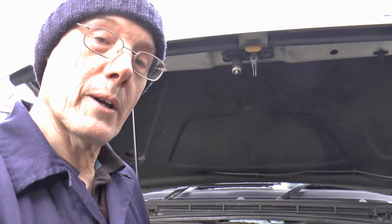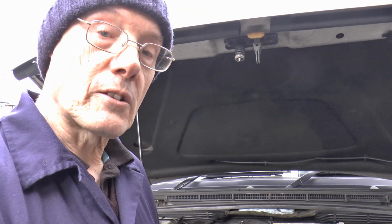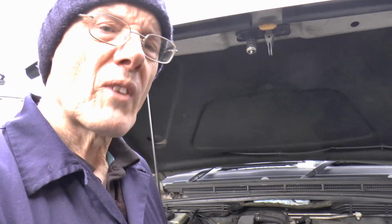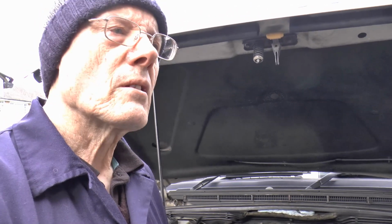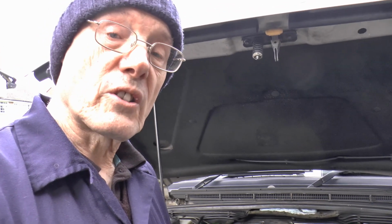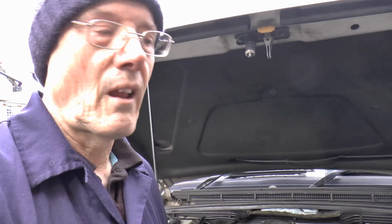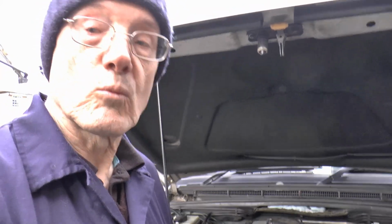Morning all, welcome back. Battery died last night, both of them. That little job took 4.5 hours, real time. Hideous. Not entirely happy with it either. I was hoping to find some kind of damaged seal or something else that might explain the amount of diesel going into the oil. Didn't really, it looks okay. So if the problem persists after this, then it's a cracked head. Bloody marvellous. Anyway, we'll just have to see, won't we?